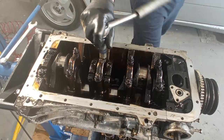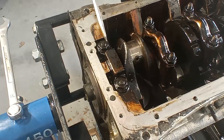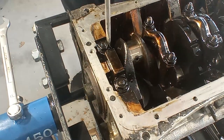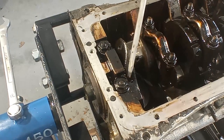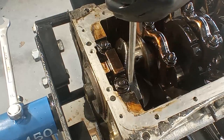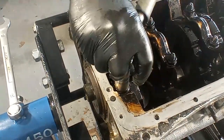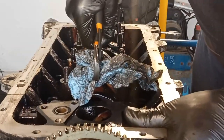Taking out the support bearings for the crankshaft, just to see the state of the bearings and know if the crankshaft is good for reuse — since I don't know the condition of my Alfa 75's crankshaft due to the bent con rods. This is a remnant of the old Bialbero engines of the 105 series — this one still has the metallic tabs to hold down the nuts. Taking those out carefully, trying not to break them. Now removing the supports themselves to evaluate the bearings.